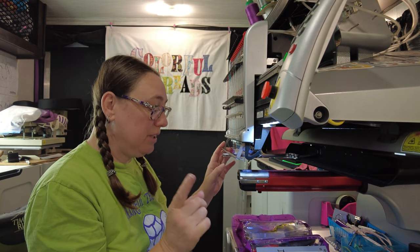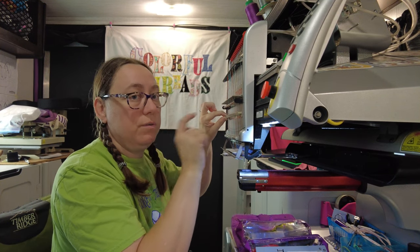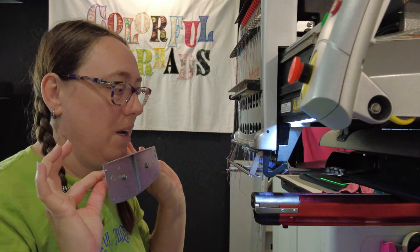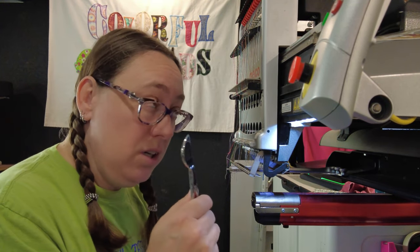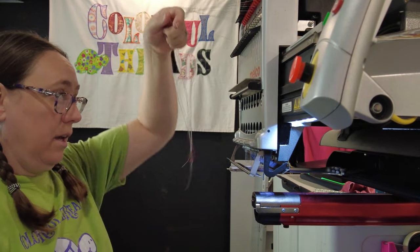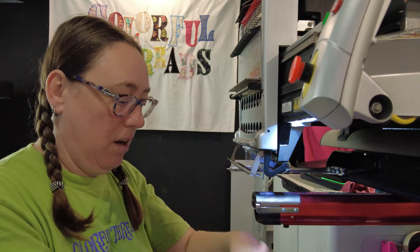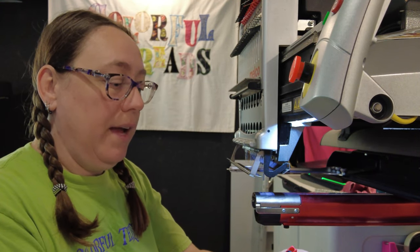Pull up a chair and be prepared, because you're gonna do things to replace this that will make you cringe. The first thing we're gonna do is take off this little magnetic clip where the felt pads are. Just grab it — it's held on with magnets — pull it off the machine and unthread everything. Set it aside. Then pull out a pair of scissors and take all the threads from the top, get them loose, and cut them all. We need all of these off the machine.